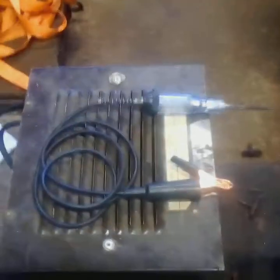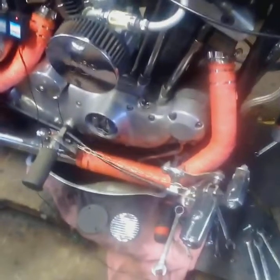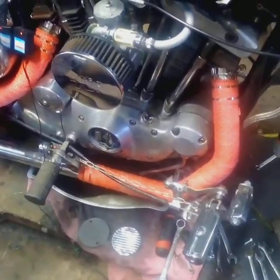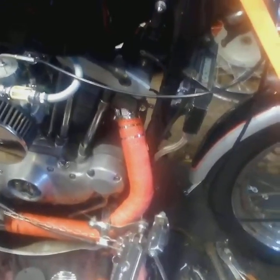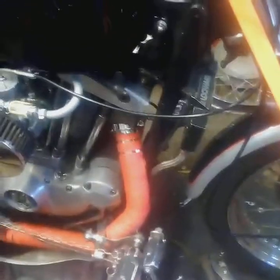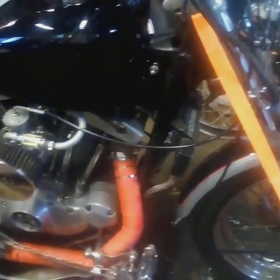This is what I was doing all the testing with, just a regular test light, negative to positive. Put the clamp on negative and start testing. You didn't have to put it on anything. You could see it flashing in the points. Up here at the coil, I touched it on there, rolled it over, and the light was flashing on and off like it should be.